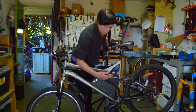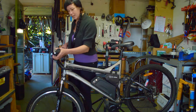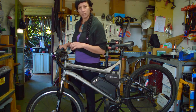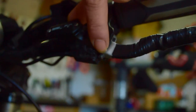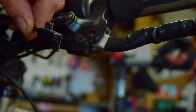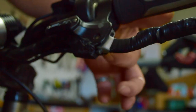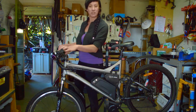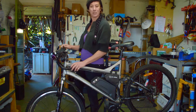This one's fitted with a mid-mount motor, so we don't need to talk about the wheels — they're left as they are. When we come up to the handlebars, this has hydraulic disc brakes. Neither the brake levers that come with the kit nor the cable sensor we looked at before work for this bike, so we're using one of the magnetic sensor types. Here is the brake sensor, which has been glued and siliconed into position, and the magnet is on the lever. When the magnet moves away from the sensor, that cuts power to the motor. With the mid-mount motor, the handy thing is that the front derailleur is gone, so there's no shifting gears on the left-hand side anymore — a great place for the throttle. And you can indicate right with your right arm whilst using the throttle, which is pretty handy.